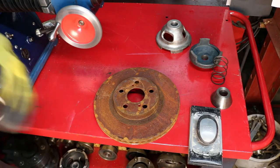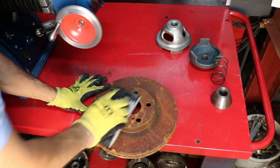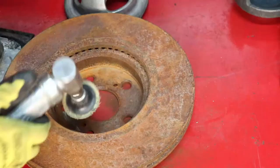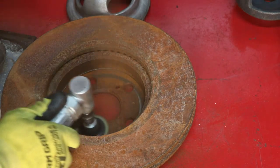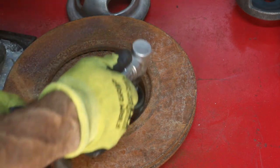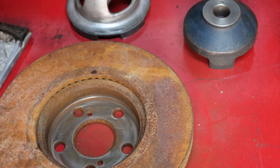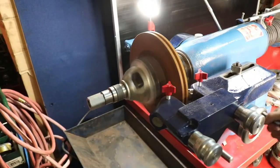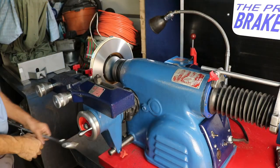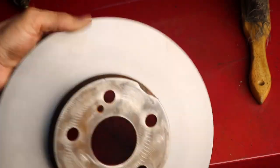Now let me show you the proper way to machine rotors and drums. Lots of shops where these services are offered are supposed to do this, but most of the time they don't — that is, cleaning the mating surfaces that are going to be referencing a good geometrical plane to cut the rotor or drum, both on the lathe and on the car. I've seen rusted pieces machined, but the contact planes are rusted or with metal contaminants. These surfaces need to be pristine to eliminate vibration due to inappropriately mounted or torqued rotors. You can see how this rotor is uneven and warped, but after a few passes and a final slow cut, this rotor is like new again. Of course, you have to measure to comply with the thickness tolerance and be within specifications. Thanks for watching.